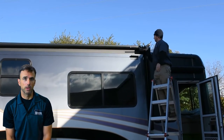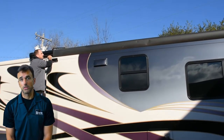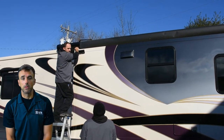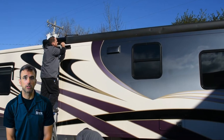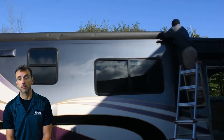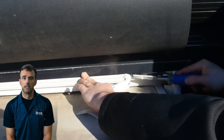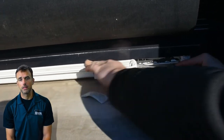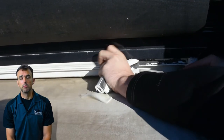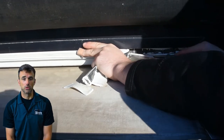Those awnings are good for keeping debris off the top of the slide-out, but it is an involved process. While this is a project that a number of you will be able to do, we do recommend the use of professional services if it gets a little more detail involved. Here you'll see Greg and his team using stepladders. This is a close-up shot of them taking a look at that top seal that wraps along the upper edge of the RV, and they're going to start pulling that off. Once the awning has been pulled back and removed, the process is to cleanly remove the old seal.